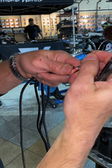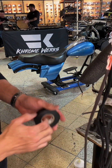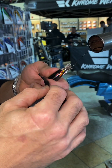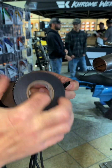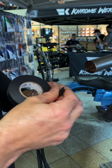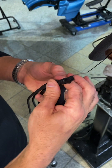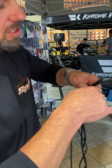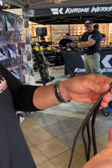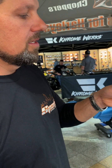You've got all these wires — there's a lot going on. We've got some tape here and we're going to go ahead and wrap these up. Wrap tape around, make a nice little point. When we do the Harley heated grips, I only like to run the tape just down about a little over two inches, because we're going to need access to this at the bottom.